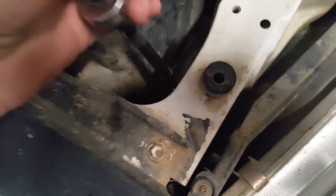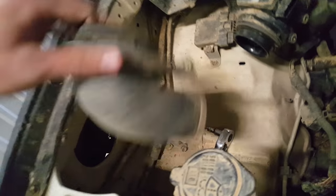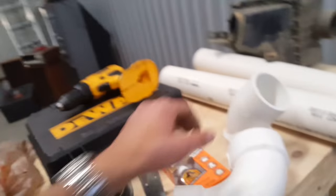There's also one down here — that one's a 12mm — I'm gonna take that out. Got that 12mm out; now there's gonna be another 12mm right here, and that should — keyword 'should' — be the last one. Alright, airbox is out. I took out the little piece where the airbox connected; it was just two bolts and it came right out, actually really easy. So this is the hole we're gonna be using, and hopefully the PVC fits this end.